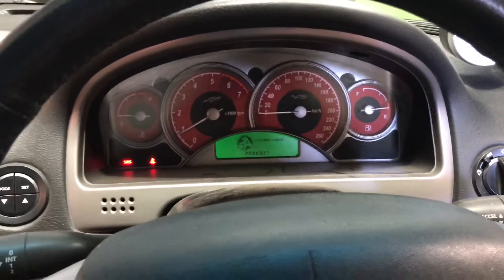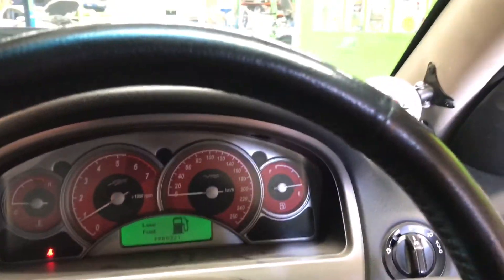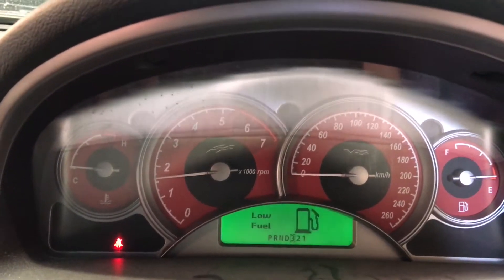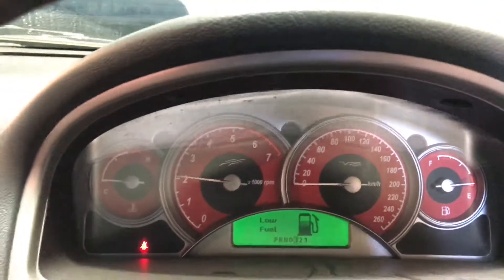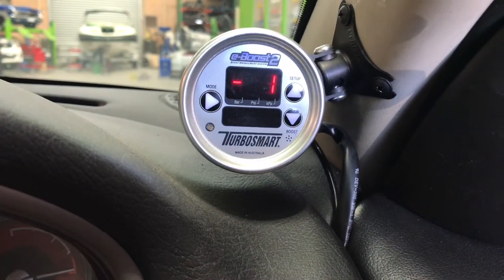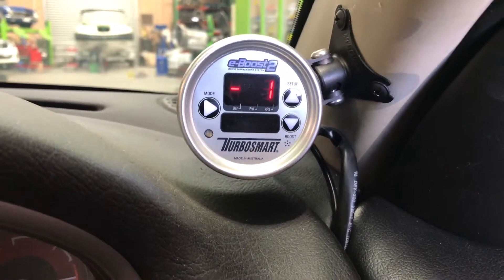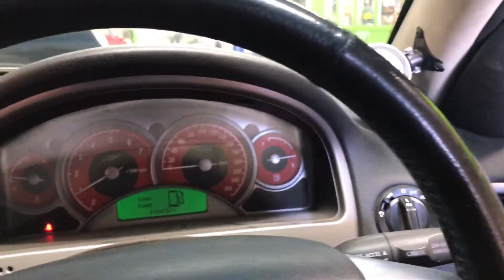Okay, I'm going to put the trans brake on. Now the trans brake's engaged, so we'll watch what sort of stall speed we get. It pushed to 5,000 RPM — 16 pounds of boost.